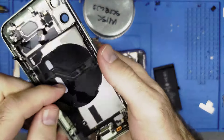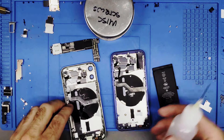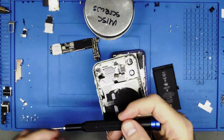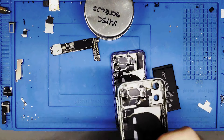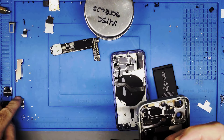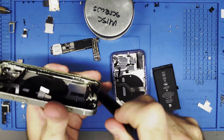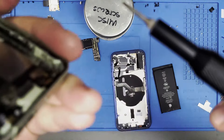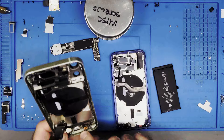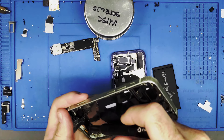I need to remove all the old adhesive off the battery since I'll be putting new adhesive down. I'm wondering how easy this battery will be to take out — there's some adhesive across here. I have two options: drop a little alcohol in or heat it up. I also need to take some screws out first — they're on the side of the frame, so I'll place those screws well out of the way. There's also a hidden screw and a couple of screws at the base of the charge port.